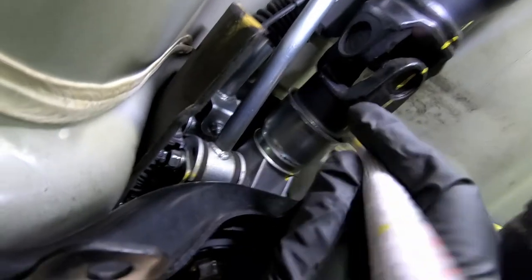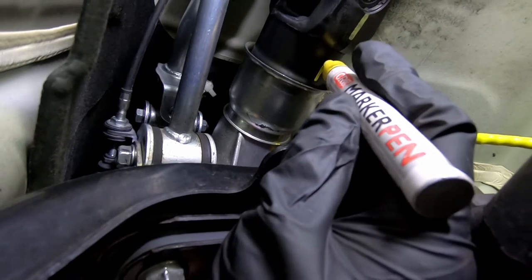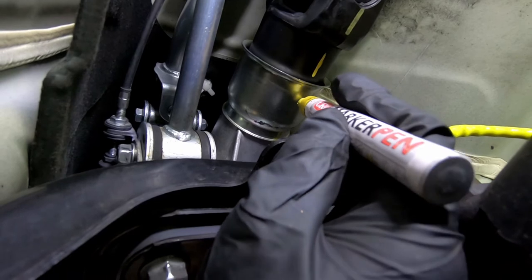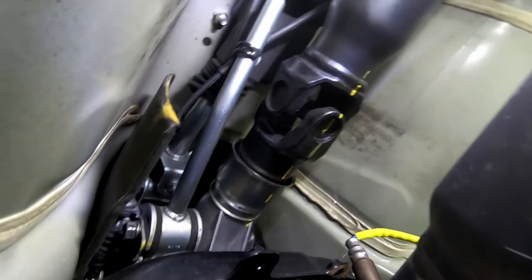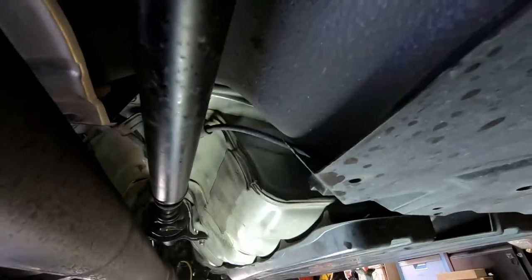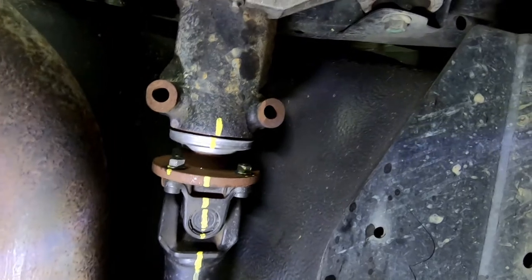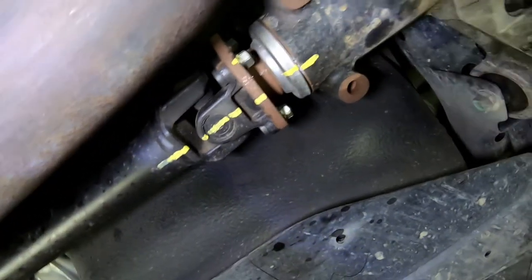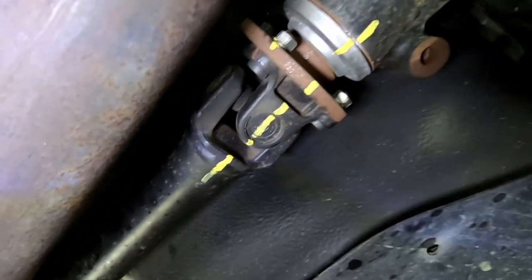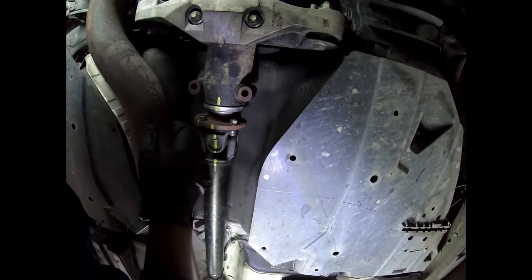You do not need to do this on the front, but I just prefer to. I like to mark the drive shaft because this vehicle has never been taken apart before. Mark it to the gearbox and to the front of the prop shaft — just make a line so when it comes time to reassembly you can line it up in exactly the same spot. It's not necessary for the gearbox side, but for the rear differential it is crucial. Make sure you mark the pinion flange and the drive shaft. Make sure the marks are clear and won't come out — this is a very important step, do not miss this.